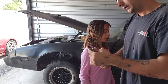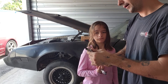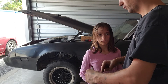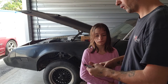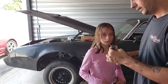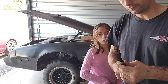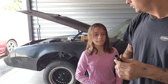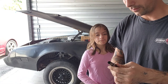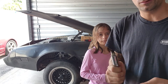It's probably just dirty, it needs a wash. It usually means that the ratio of air and fuel going into the engine is wrong. Sometimes it's too lean, sometimes it's too rich. In this case, I'm going to say it's running way too rich. So I'm going to check some of the other plugs and it looks like we're going to be replacing spark plugs, and we'll gap the new ones, not the old ones.